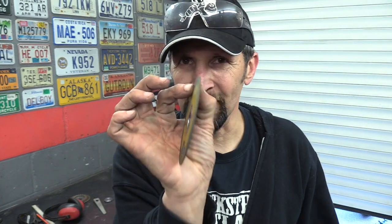There's your stock cut. Now, just another little nugget for you, if you want, as I like to do with these things, slitting discs. If you're going to use 1mm thick discs for cutting steel, obviously you only use 1mm thick discs for cutting steel. You don't use 2 or 3mm, they're for grinding. But for cutting discs like this, there's a couple of do's and don'ts.